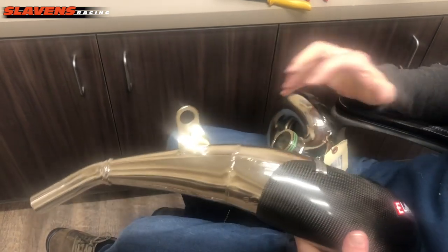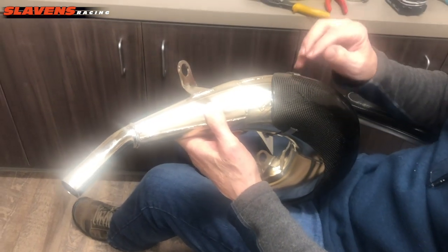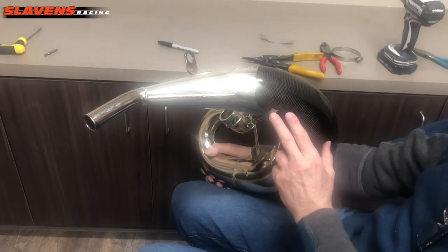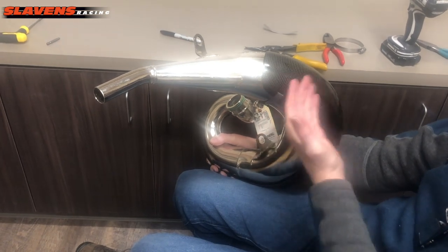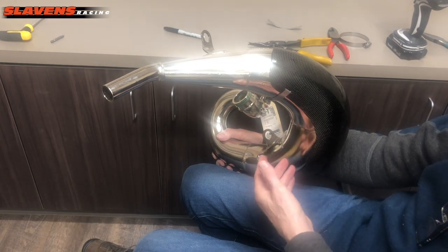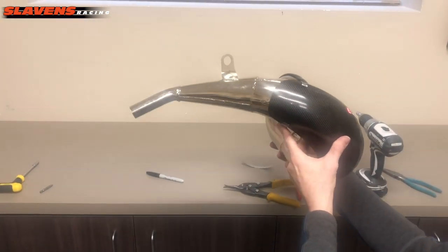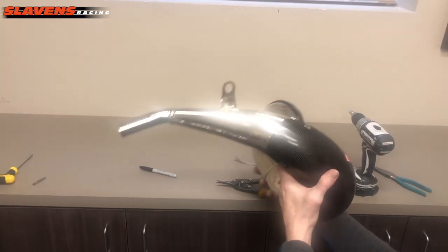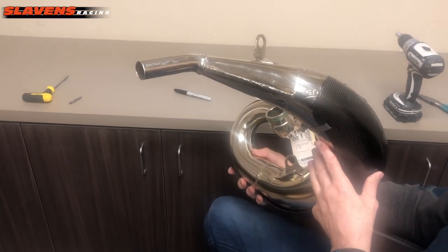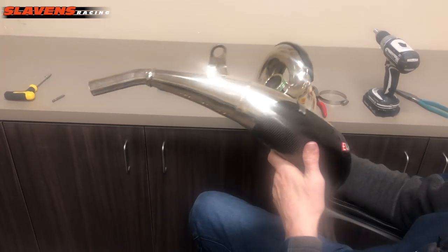After I get both of them on there, I tighten them up a little bit at a time to get it nice and snug. After the first ride, the heat will change things a little bit, so I come back and snug it up again — that usually pulls it in a little bit even tighter. So it's pretty clean that way. You don't have the hose clamp running across the guard, and you don't have the hose clamp underneath the guard, which I've seen guys do, but that brings the guard way out and makes it so even more stuff gets underneath it. When it's mounted on the bike, you're not even going to see the head of that hose clamp. And that's really all there is to it. There's probably better ways to do this — this is just my way. It works for me, looks clean, and it's pretty simple to do. That's all for now, guys. Thank you.